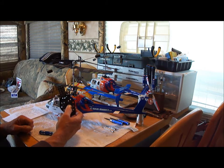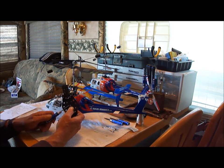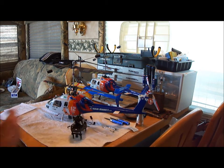Okay, now once you put in the extreme gears, you don't need that side step lugen, because the extreme gears have a raised area that takes the place of that side step lugen. But if that's missing, that's also going to cause you problems. So you want to check that.